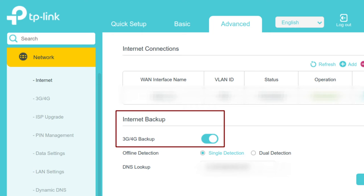You want the cellular to be the backup and ISP to be primary, so enable this switch. I can't think of a reason why you'd want it the other way around — cellular primary and ISP backup. The vast majority of people switching into wireless router mode, and especially those looking to use 4G as a backup, are going to want to select 3G/4G backup.